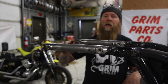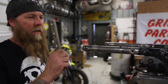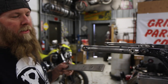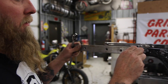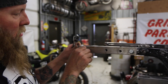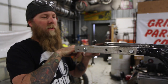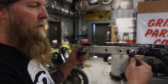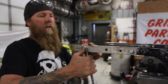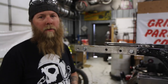We're going to install the jigs next, then take a few measurements and get ready to tack weld this together. Your kit comes with jigs and plates — they're going to look a little different than these shop ones — and your hardware. Just line everything up. This will ensure that your distances and everything are right and it will also help with squareness. There's a measurement center to center back here that you're going to double check once we get everything tightened. Tighten these guys up — they should roll around a little bit. Get them in place, do the other side, take a measurement, and then we're just about ready to tack everything together.